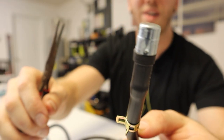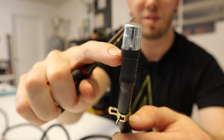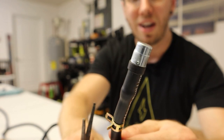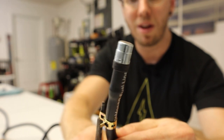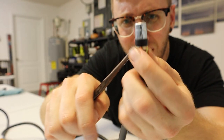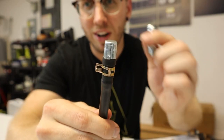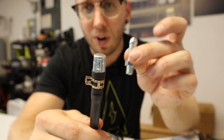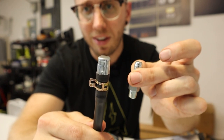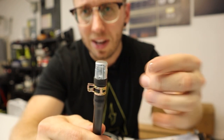As you can see, we have a nice snug fit and the hose is all the way up to right at the edge of the diff breather. Move the hose clamp up into place and get it worked in. With one end of the hose hooked up to our diff breather, we want to go ahead and install this fitting where the OEM diff breather is on the top of the diff. This will just thread into place and we'll put the hose around this and clamp it.